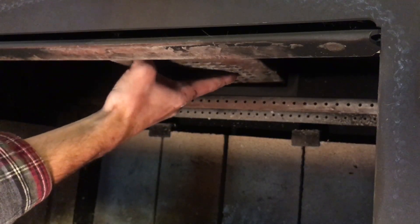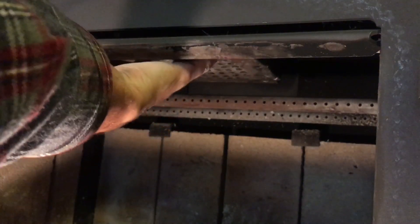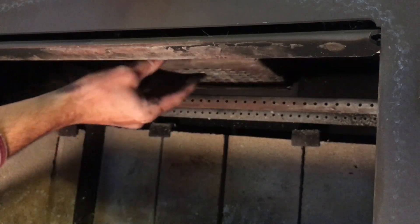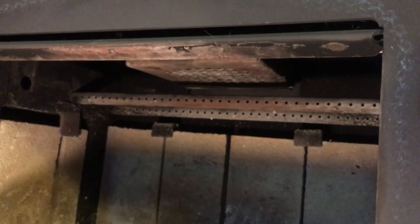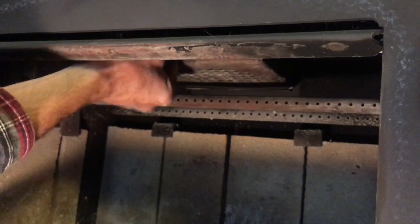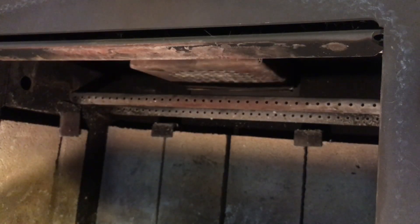The other thing you have to do is get that front part in. I am in the groove on the back and then right here is that front tab. There we go — I'm now all the way through such that I can get this little clip in place. That clip goes in and now that combustor's back in there. You can see the struggle — that's not something you want to be doing all the time.